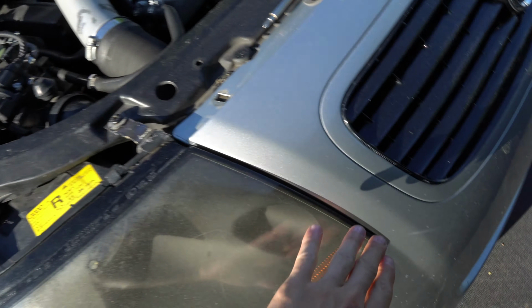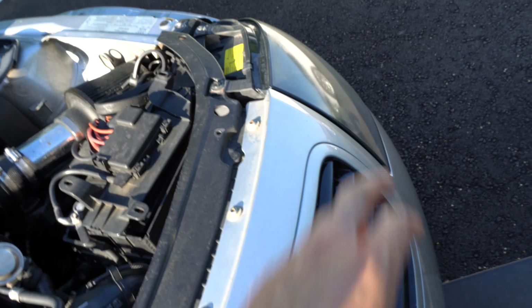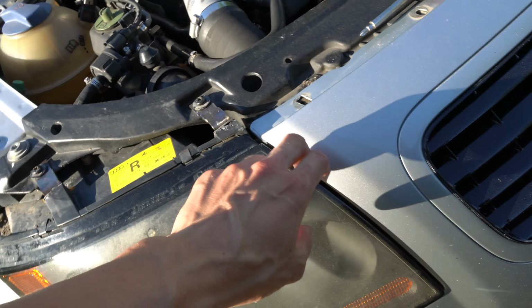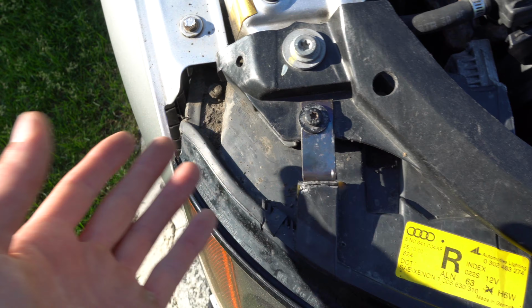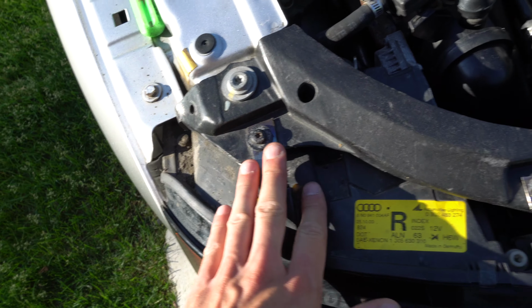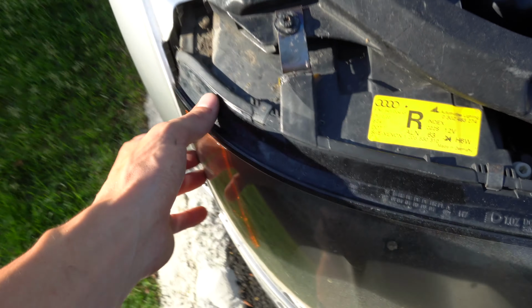And let's check out these mounts. So I went ahead and I adjusted these a little bit more, and this is fitting up really well, just like this side. And I wasn't sure how close the gaps were supposed to be, but honestly, I knocked it out of the park. As you guys can see, this is a little bit offset. Thankfully, we had the opportunity to drill that 1/2-inch hole because we followed the original brackets, and this thing is just amazing. It's really sturdy, which is really cool, because sometimes when you make these thin brackets, it's not as sturdy, but I've never made something like this for a headlight, and the headlight doesn't weigh too much, and it kind of has a little pocket it goes into so it doesn't move. But let's go ahead and let's paint this.